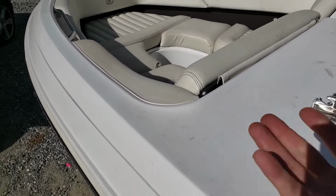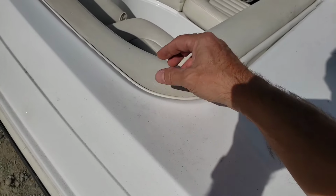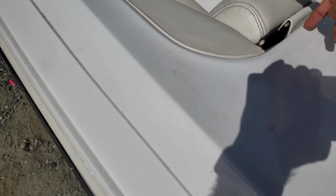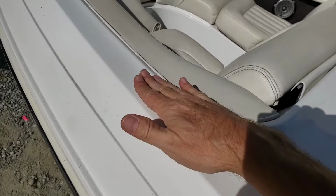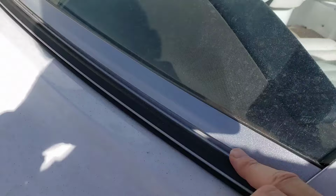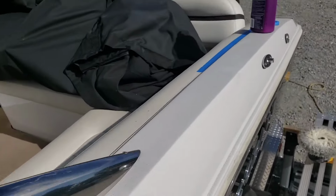All right, on the top side of this, there are some things that I have to do. There are things that you would have to do if this was your boat. One of them is to tape off all of your vinyl. The reason is that as your buffer wheel is going over, the last thing you want is for it to polish up or impart some color of the compound or the dirt into the vinyl. So tape it off. If you're not good at controlling your buffer, over tape. Tape off a good 3 or 4 inches all the way around, especially when stuff is flush and almost touching. You definitely want to tape those off. You want to tape off all the black trim so you're not shoving a bunch of white compound into that. And as you go further down the boat, there are more examples of this.